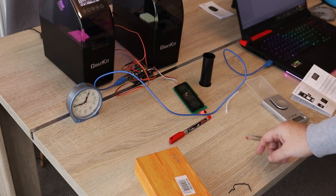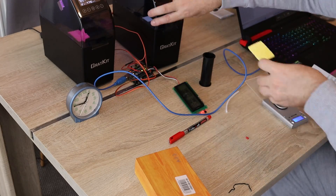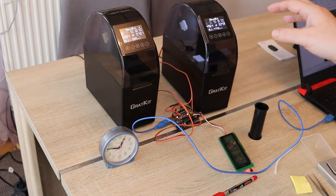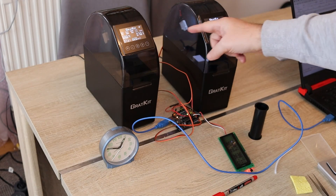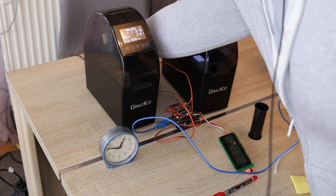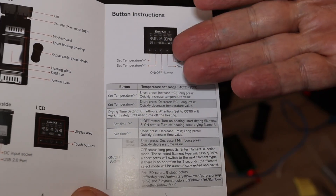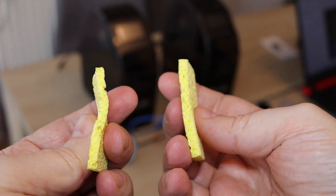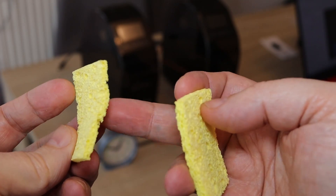It's time for the one hour measuring. The temperatures inside stabilize at 73°C in the new dryer and 53°C in the old dryer. For the next 10 minutes I want to collect cooling data, but I still couldn't figure out how to turn off the dryers via the user interface — it's not even mentioned in the user manual. This is called an on-off button but it doesn't work as an on-off button, so I can always use the application to turn it off. Look at this — the new dryer's sponge is completely dry, while the old one is still wet. The new dryer definitely works great.